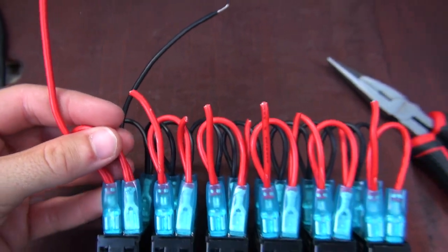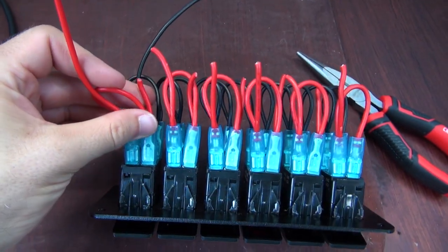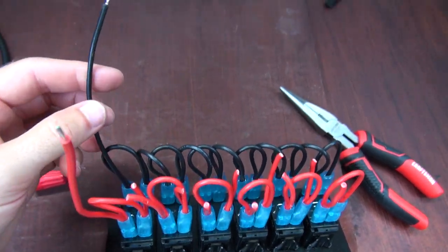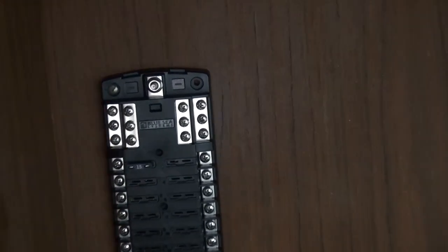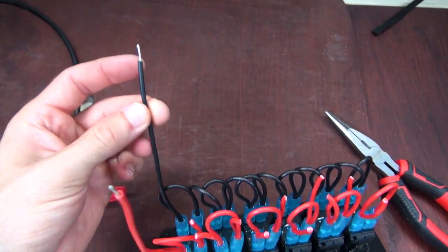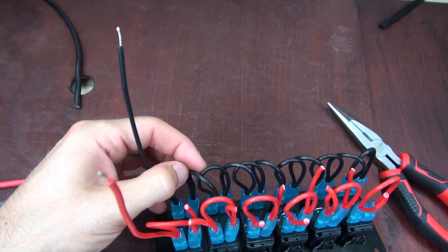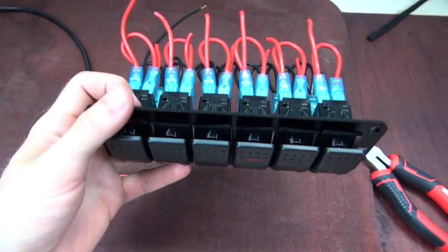What I've done is clipped them all so they're all separate. I'll have one wire coming from one circuit on the fuse panel - one of those fuse panel circuits correlates to one of these positive sections of switches. I only need one wire going in, so I'll most likely just put wire caps on the ends of the others. The same thing also applies for the negative, so I'm going to clip these as well. Originally I thought about just running the negative straight back to the negative plate, but if I have too much current flowing through each individual switch, all the current would travel back through this one wire which I'd guess is probably 14 gauge - not the safest move. So I'll clip all of these so each switch gets its own independent 12 gauge wires running back into the fuse panel.